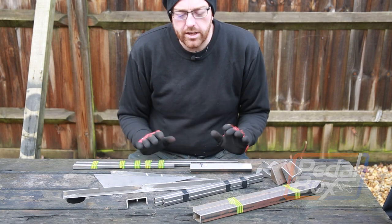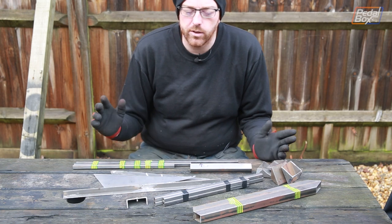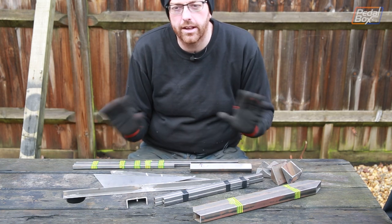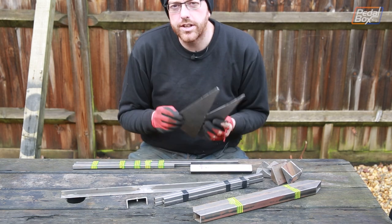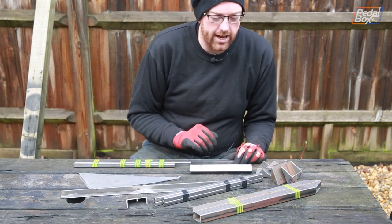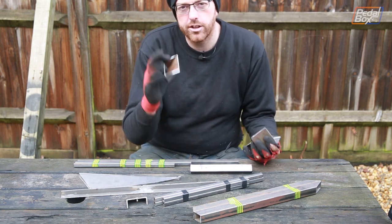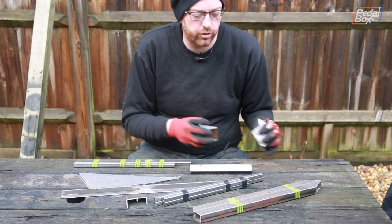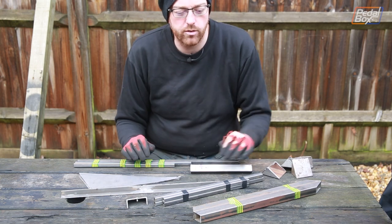While we've not had a welder I've been making some progress getting some pieces ready to weld in as soon as it comes back. Now it's back we can start welding. There's a bunch of different parts here from the front and the back of the car, really just catching up on things that we haven't fit already. These two panels finish off the rest of the engine bay at the very back of the car, and these little triangles go on to the rear bumper bracket to close that in a bit better so it doesn't get shmoo and dirt inside that bracket where it might rot out.